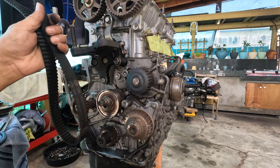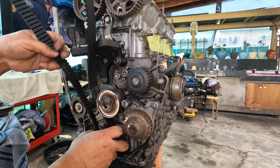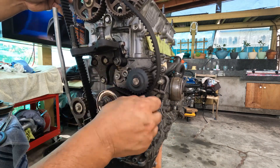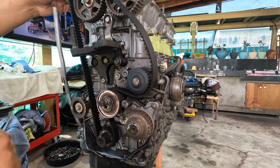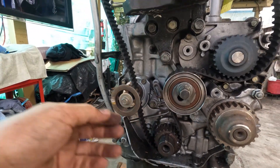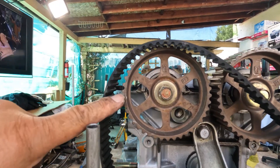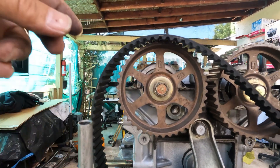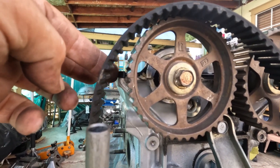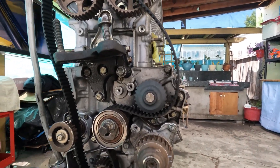So the timing belt goes in. The timing belt — everyone is different — but at the end it all comes out the same. From here I'll stretch it and line it up, aligning the slot right there to the flange of the cylinder head, or more like the seal right there. Let me set up a camera here.